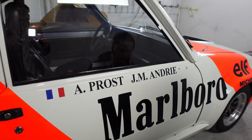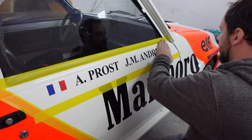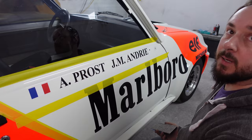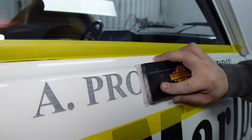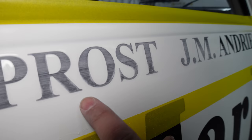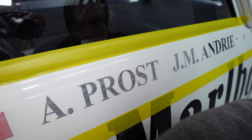Let's protect where we don't want to make a mess first. What grit are we starting with? A bit of Mirka Iridium 240, just to knock the lacquer off so we can pick up that sticker. Let's have a look at this. These are numbered. That's the lacquer - the clear coat - just getting knocked back. Starting to go through. Can you see it? Look at the way it's looking different around the art there - it's like a shadow almost. Yeah, that means we're through the lacquer.